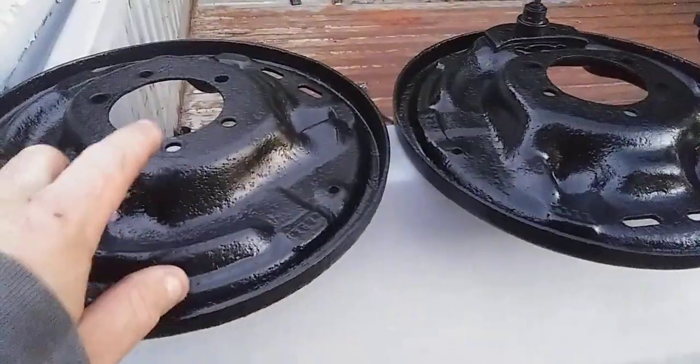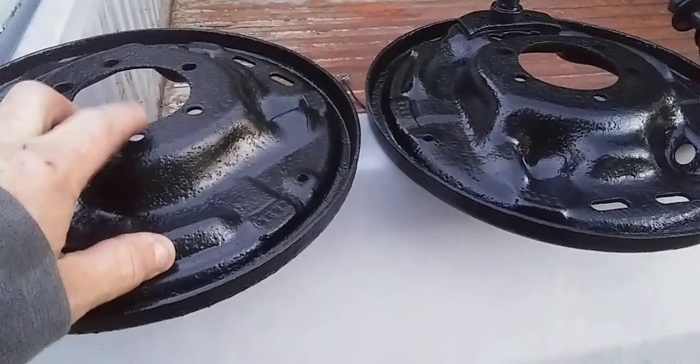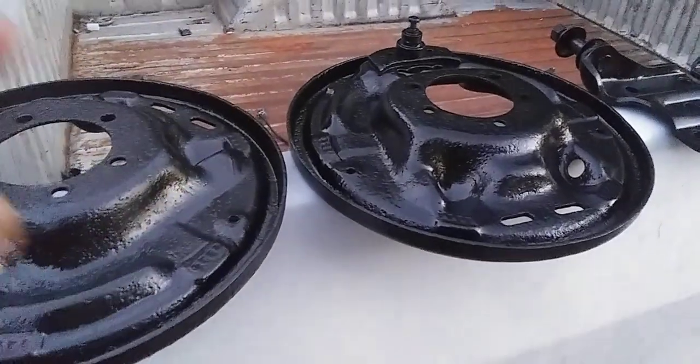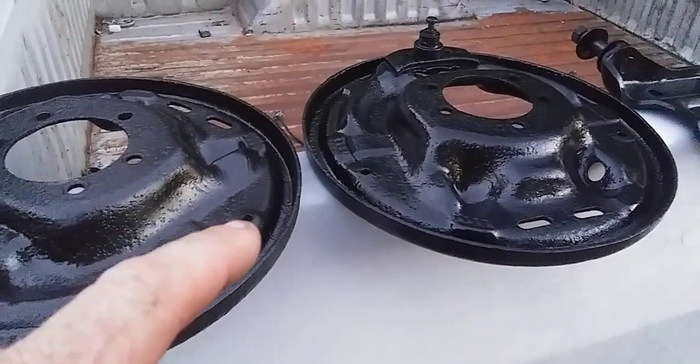Got all this done. I'm going to have to get new bolts for the front of the axle housing ends. On payday last week, about seven in the morning, I got on Mancini Racing and ordered the 8-and-3-quarter U-bolts — Mopar Performance ones — the ones with the flat undersides with the crisscross pattern that protrudes out.